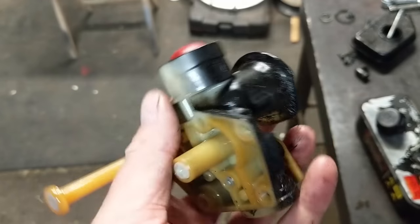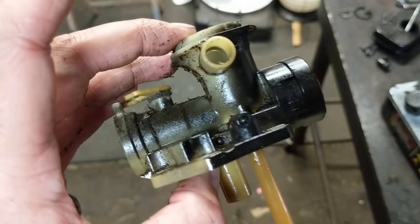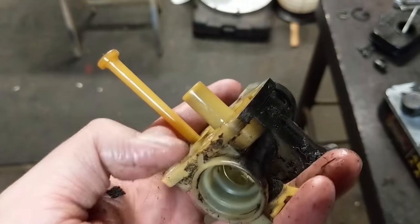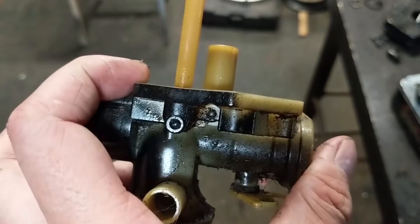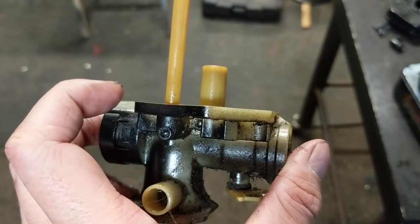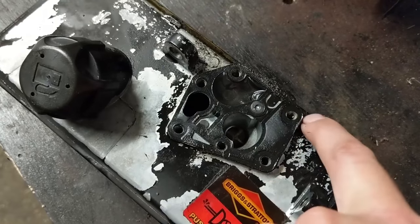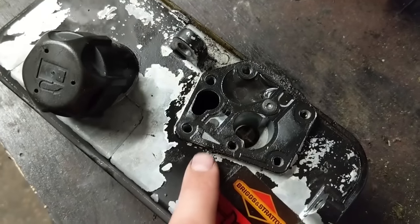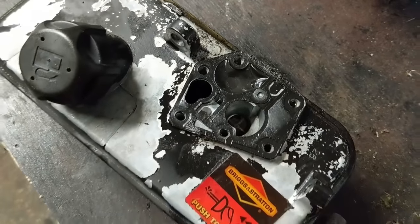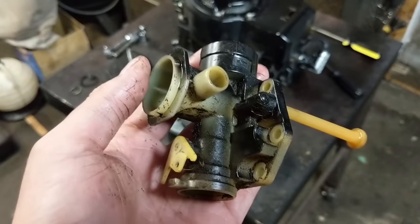One thing I want to make note of is that this is a plastic carburetor, and the biggest mistake I see a lot of guys make is they put these into their ultrasonic cleaners with hot water and a cleaning solution like a degreaser. Because it's plastic, this carburetor can warp around this edge here — this edge is supposed to be perfectly flat. When you go to reinstall it onto the fuel tank there's a large space between screws, and what I see is that after carburetors have been warped they'll leak right here, or here, or at the back. So the biggest thing is to just use lukewarm water — these things are so easy to clean, you can do it with a little bit of dish soap and a garden hose.